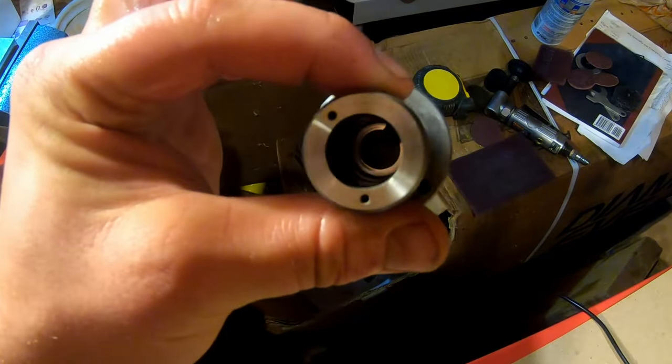The reason we're doing this is because there's very tight tolerances on this, and so having some oil on it will lubricate it going in and for startup and stuff like that. And the diesel, because it's sort of similar, diesel has a little bit of lubricating quality, and it'll help the parts go together and clean off any last bits of dust and grime. So I will pick them out and shake them off. All right, let's do some reassembly.